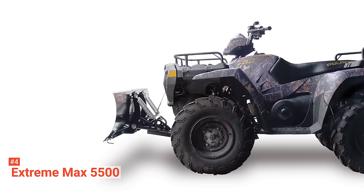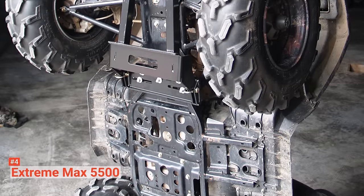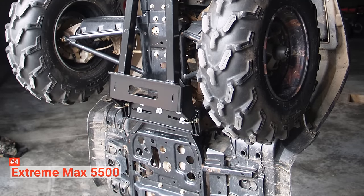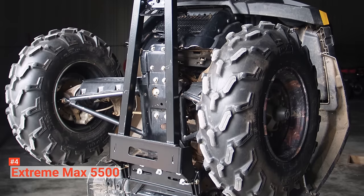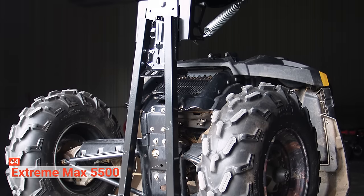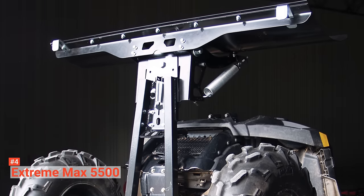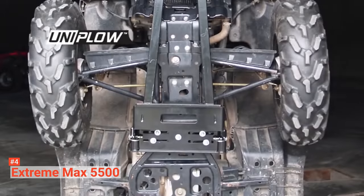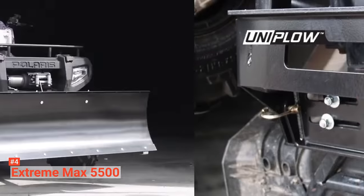This snowplow has a push tube design that easily mounts the plow for quick and convenient installation. Once mounted, its quick release mechanism enables you to attach or detach the blade and push tubes without removing the mount. The snowplow includes grade 50 gusseting and a steel wear bar attached with grade 8 bolts and heavy-duty adjustable skid pads that protect the bottom of your blade from undue damage. Lastly, the kit comes with everything you need to get the job done and carries a 1-year warranty.